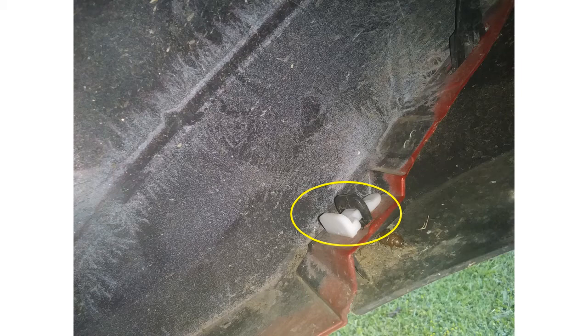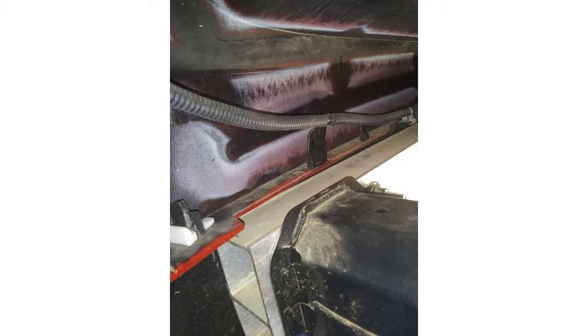You do have to remove these white tabs. Push down with a screwdriver on the small side and push out at the same time towards the larger side. There's that screw and tab on the other side — that's the passenger side. Remove the screw and push down the tab. The harness fastener does not really need to be removed — leave it in place.